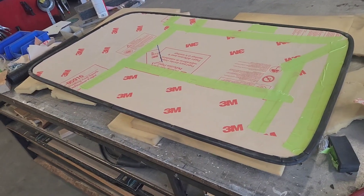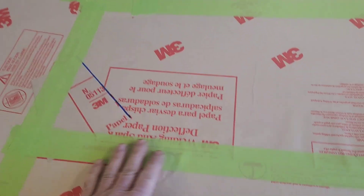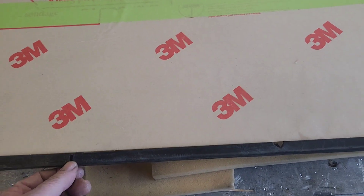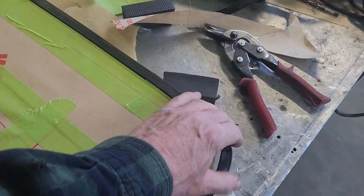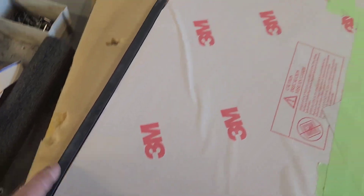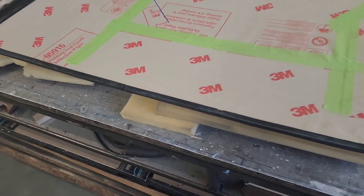I'm about to begin the adventure of building the window plug for the rear window of this car. The first thing I did was protect the back surface of the glass with some spark arrestor paper. I also took this 3/32nd C-channel rubber that came as a packing protector on the last project's windshield and put that around the perimeter to protect the edges from chipping. I'll take that thickness into account when I design my surround and window bed.